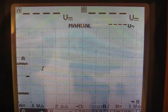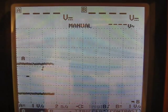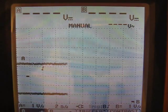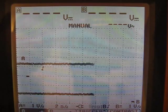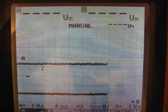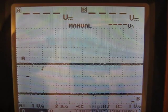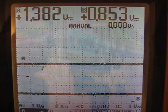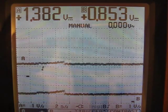So this is currently set up for my bicycle as I was riding it tonight at six kilowatts. It is a crow motor running 100 volts at 60 amps, so it's inputting about six kilowatts. With sag I'm seeing about 5.7 kilowatts going into the motor. And it's actually very easy to control.